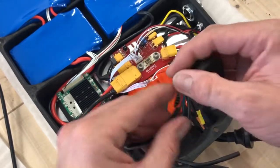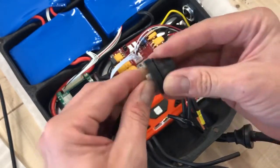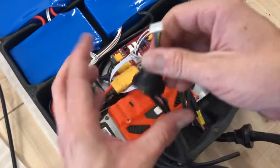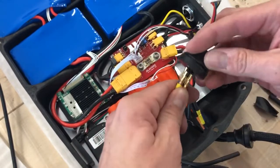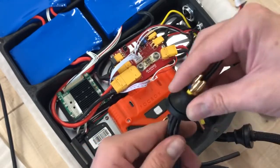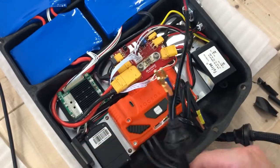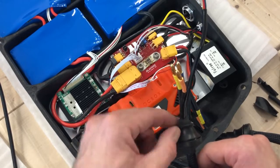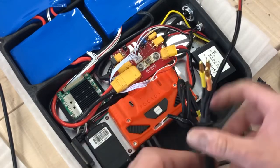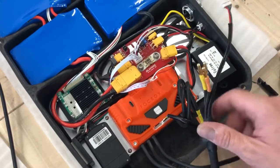You want to always go its own way. If you want to put it back, you can bend it a little bit like this, press it on the top, and you just have to get these three cables as close as you can together and push them inside. It might be a little bit of a challenge sometimes — you may have to go one cable at a time. Once it's on the shrink, make sure you have about a quarter of an inch or a bit more than a quarter of an inch over, and at least a good half an inch in the back.